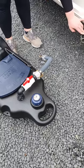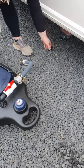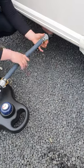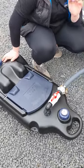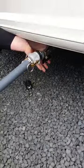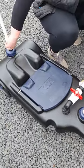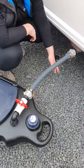Just behind your wheel here, this little piece is the outlet for your grey water. When you're going to connect your caddy, take this cap off. You've got this grey water hose — you connect it to the caddy into your van. These cam locks are a little bit stiff because they're new but they will loosen up over time. You've then got a piece of pipe that goes on the end of your caddy for your breather. Once you've got that all hooked up, you need to make sure all your valves are open — there's one on the breather, one at the top and there's also a valve underneath the van. You do have a little gauge on the top so you can keep an eye on when it's getting full. When it's getting full and you want to empty it, make sure you close these valves, and it's also a good idea to close the one underneath the van, just to stop some of the residual grey water in the system coming out onto the ground.